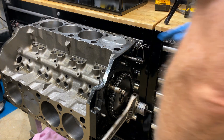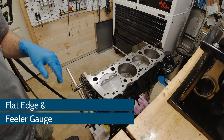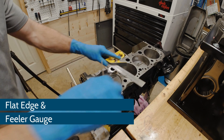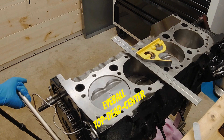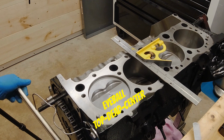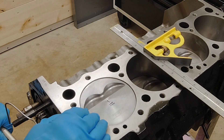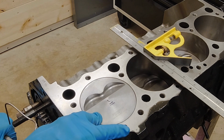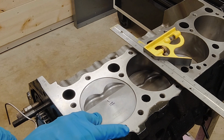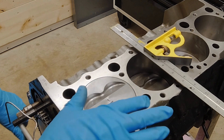The first method I'm going to show you is basically just by eyeball and the feeler gauge. What I do is eyeball when the piston comes up to the top, because there are a few degrees where it just dwells at the top. Just feel — go past it a few times, where it stays at the top, back and forth. You know it's right there. That's just by feel.